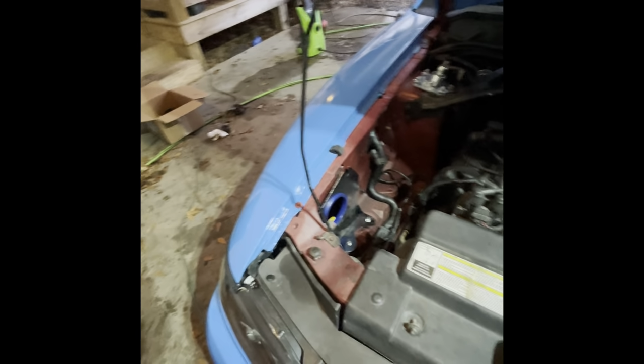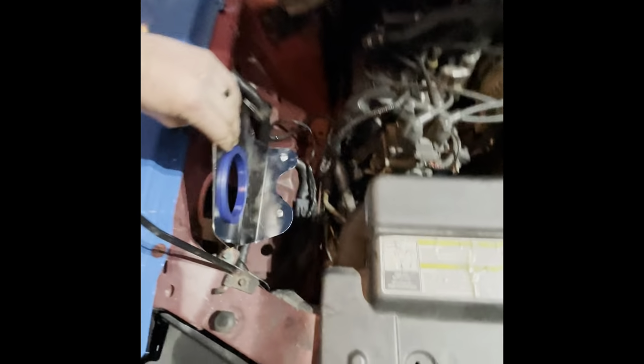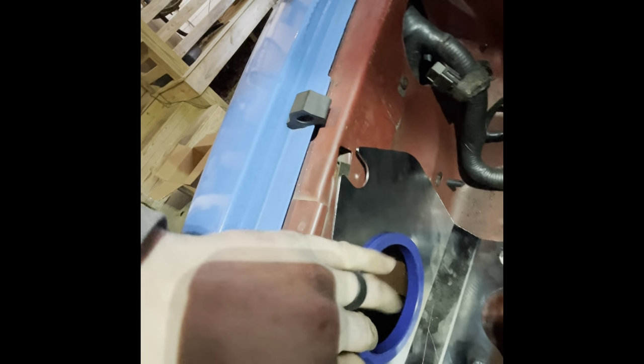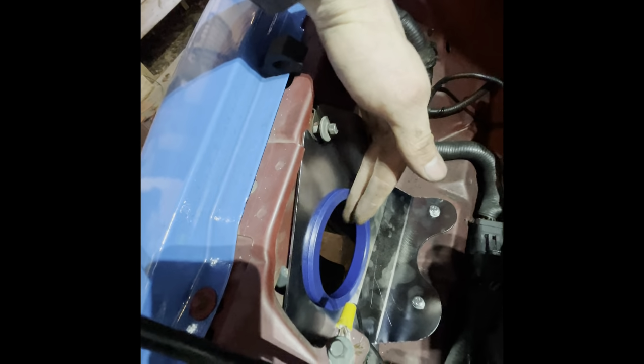So we can come over here and get this little block off plate setup. All right, on this you have two dowels that screw into the bottom via the bolts they supply. Normally there's apparently supposed to be two rubber grommets in those holes that those dowels slide into. Mine are missing, so I'm going to have to get some at some point, but there's also supposed to bolt into that threaded hole right there. I've got a bolt here that will go on there just fine and pinch that down to hold it in place. So I'm going to have to source the rubber grommets and find those. So we're going to go ahead and get that all tightened up and install that first.